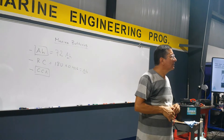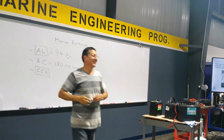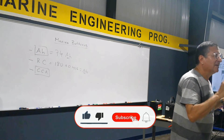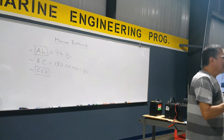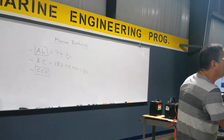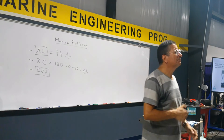It's close. But to make it simpler, I say 0.5 — half the reserve capacity is approximately amp-hours. What is half of 180? 90. Forget 0.416 — use 0.5. It's simple: half of the reserve capacity is the amp-hours. This is the information that you need. Let me explain why, because in a couple of minutes we are going to use that.